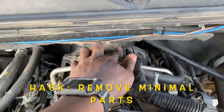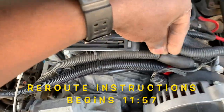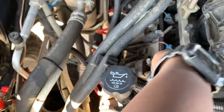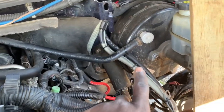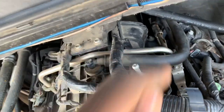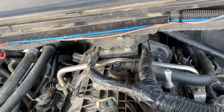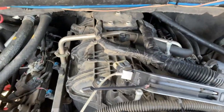I'm going to take off these bolts, get all these wires off. I have to remove the wiring and connections for the alternator. I'm going to have to remove these eight-millimeter bolts — five of them on each side that hold the intake in. I'll have to remove the brake booster line and the fuel line, and that should give me the ability to lift the intake up completely and move it out. I'm trying to avoid removing it entirely from the body, but that is the plan.